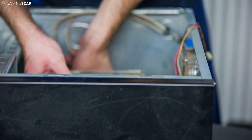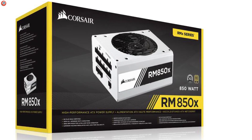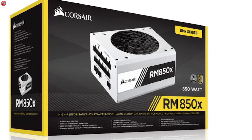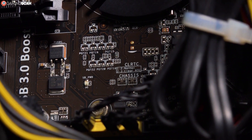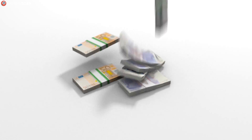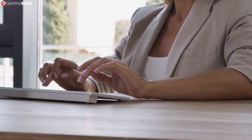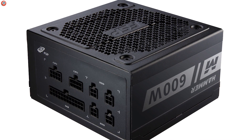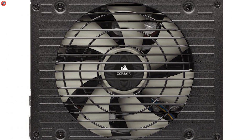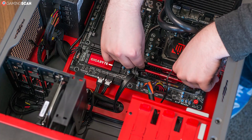But if it's all about the looks and you have plans to build the ultimate transparent case PC — where cables will not only be something to hide but an additional feature — then fully modular units are for you. Since you can replace all wires, you can start to tinker with custom wire colors, and you also get to decide on the cable length, opening up a whole new avenue when it comes to planning out the aesthetics of your build. However, this comes at a price. Fully modular units themselves aren't that much more expensive than semi-modular ones, but once you start adding custom cables — all purchased separately — the overall price starts to skyrocket. For most people, the choice really only boils down to non-modular and semi-modular. The only practical reason to get a fully modular unit is if you're building a mini ITX gaming PC, where the modularity and custom cable length will really help out with the cramped space.